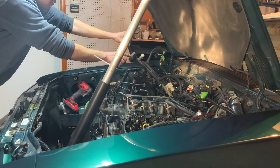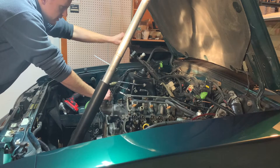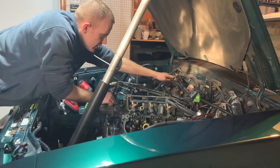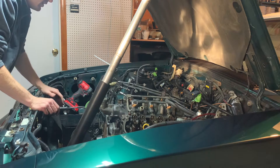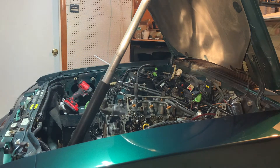Loosening the heater tube — I call it a crossover because on my Hondas that's the crossover tube — got it out. There's one studded bolt left in the back. Fuel lines are tucked off pretty good. There are little metal tabs you can kind of give a light pry on — very lightly, screwdriver-sized pry bar. It's loose as heck, that's gonna come right out.